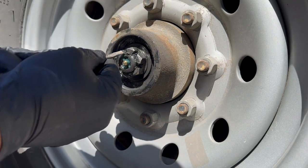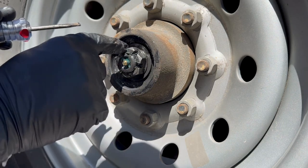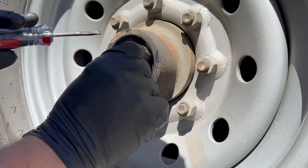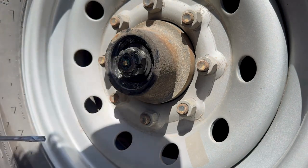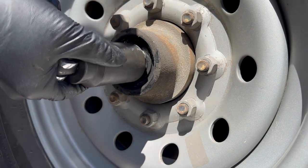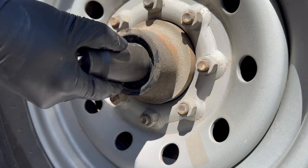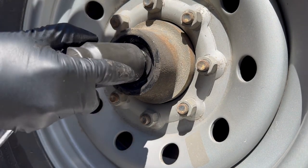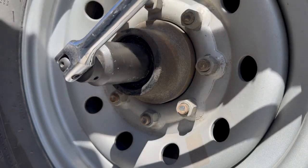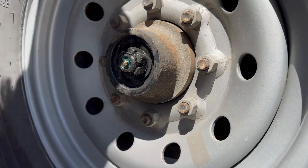There are actually two slots here - one right here and one right here - and you can use either one with the castle nut to hold it in place. They give you two so you have a little bit of adjustment from where the nut lands when it's tight. So we'll go ahead and loosen this just a little bit. This is a 36 millimeter axle nut socket. I can loosen this, and now we know we've got some play, so I'm going to turn this with real easy pressure until it stops. I'm not putting a ton of pressure on it at all.